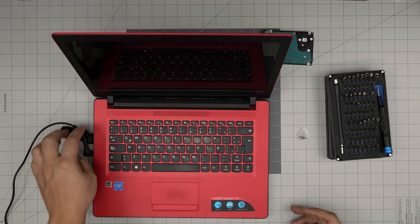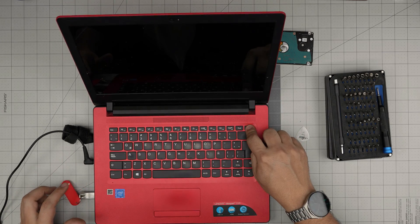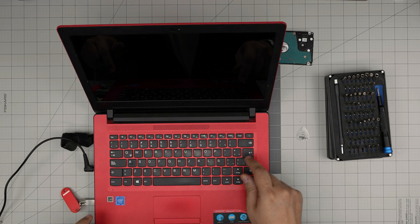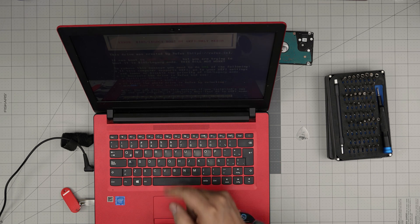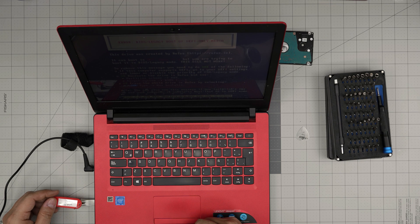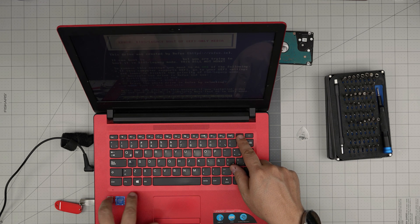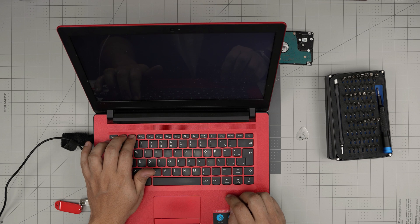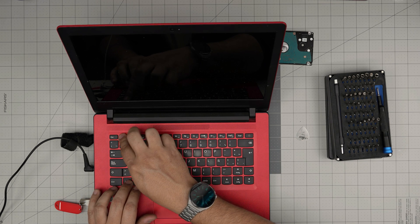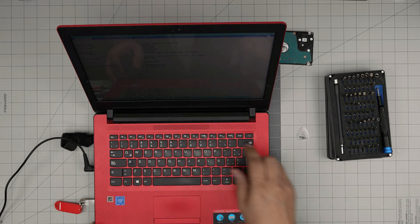That's the reset button. There is a LED light in the front for the battery. I'm going to power on — it should detect there's no operating system on the hard drive and start loading up from the USB. It says it's not in UEFI mode only, and this USB is UEFI mode. It cannot boot because it's set to custom legacy. We can fix that by pressing Ctrl+Alt+Delete and then F2 or F1. Once we go to the BIOS, press Function F1, F2, or Escape to enter the BIOS.